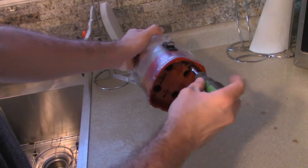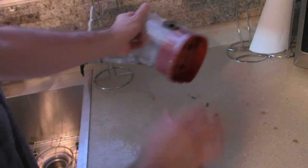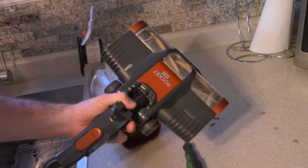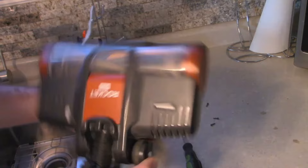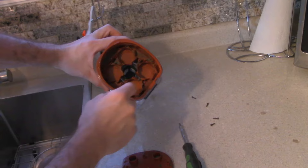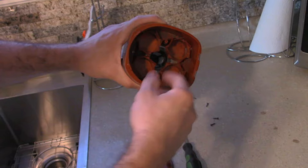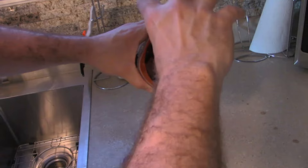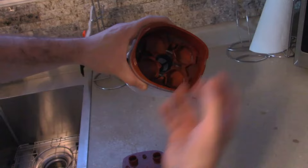These are the same screws that are inside the head unit itself, so we'll take this apart. I've never taken one of these apart — I took the other blue model apart that has the brush head, but not the self-cleaning attachment. We're going to separate these two pieces now and just kind of pull on it. As you can see, this is your cyclone area and there are actually grooves cut into the plastic. This creates velocity and flow inside the vacuum — the air comes in like your car's intake manifold. The air gets cut with the plastic, which creates more suction and velocity.